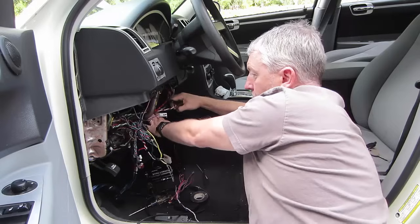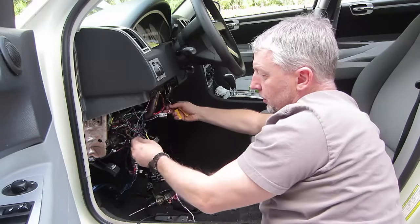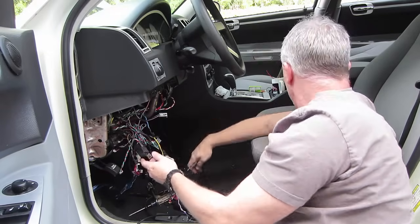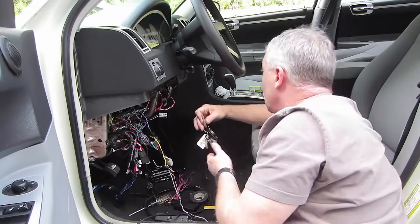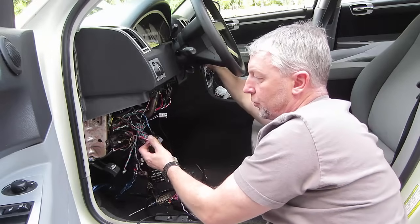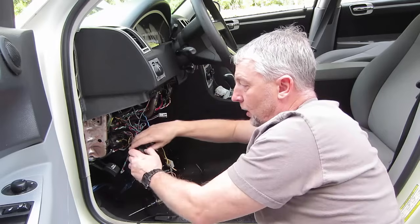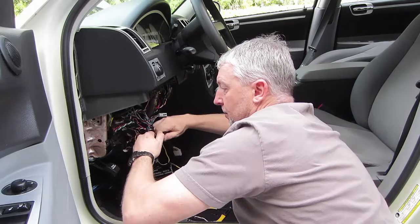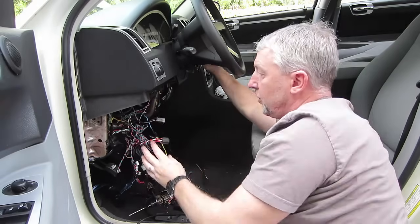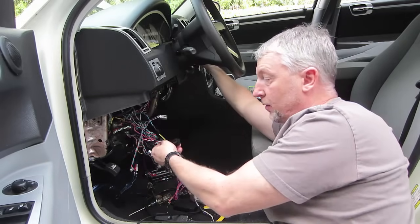This here is the wire I was talking about a second ago. This here goes to the starter kill disable relay right here. So you'll see what happens when the alarm isn't grounding the coil on this relay. It remains normally closed, but when the system is armed, it opens up the relay, which is the same as the actual relay itself being omitted, such as this, and the car will not start. So take extra care when you're working around these starter kill relays.